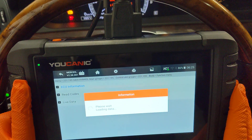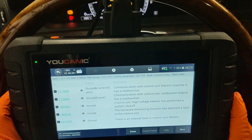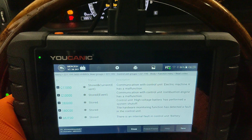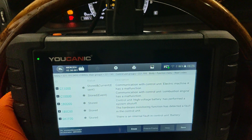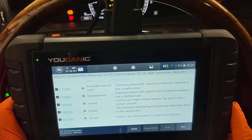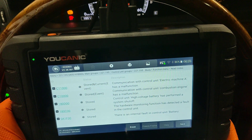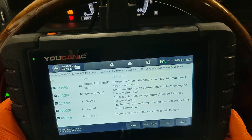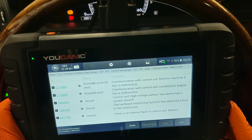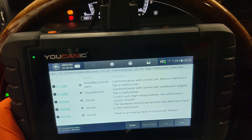The pre-charge fault is tricky to troubleshoot because the problem could be the battery itself — where the connection is made and where the BMS brains are located inside the hybrid battery — or it could be electrical issues in one of the other components. A common one is the DC-DC converter not having enough power to bring the voltage up to 120 or 130 volts fast enough. That's another tricky issue we see quite a bit on these vehicles. That covers the main diagnostic checks for a Mercedes hybrid — thank you for watching Mechanic, where you can be the mechanic.